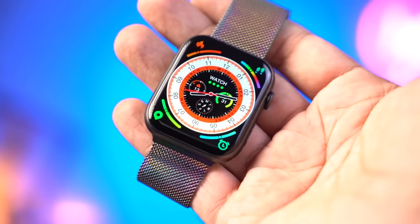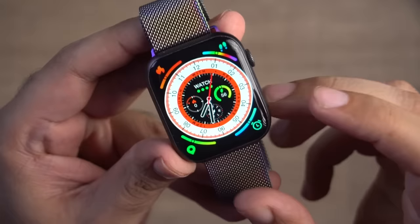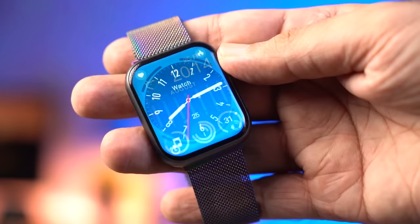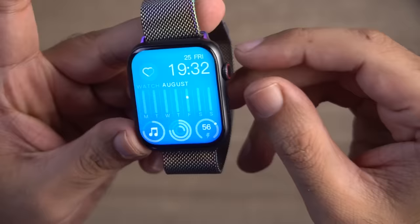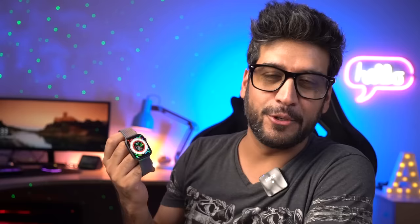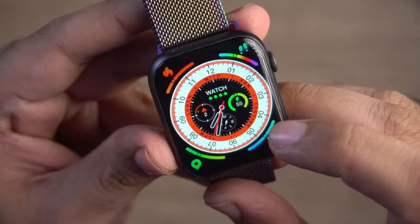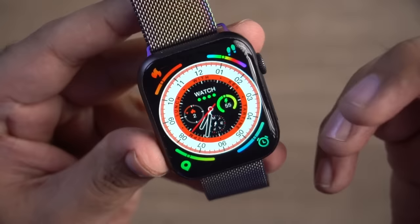Let's talk about this watch. As I told you, always on display is available. Even though this is an LCD display, the always on display option is there. Obviously the battery will consume more if you enable this feature — in AMOLED there's a little battery saving, but on LCD if you want to save battery, disable it. The screen looks very high quality. The whole watch display — the screen looks very premium. In this watch you have a very huge 2.05 inch display and the resolution is also very high: 428x518, so the text is very sharp and it's a high resolution HD display. The display is very good — very big for a Rs. 2000 price point. The brightness is also very good at about 500 nits, so indoors or outdoors there's no visibility issue.